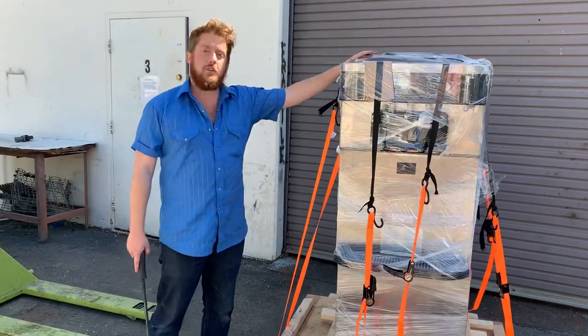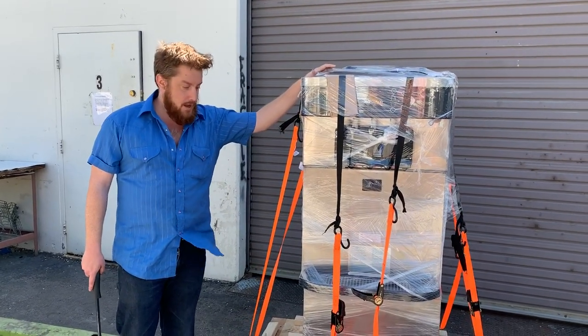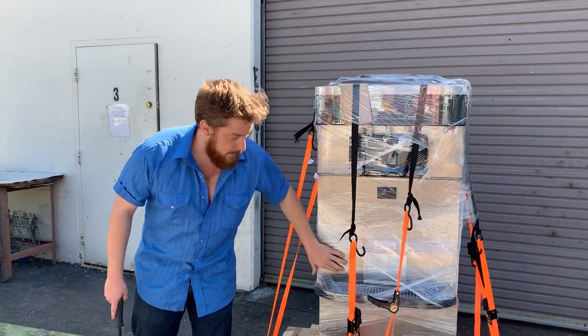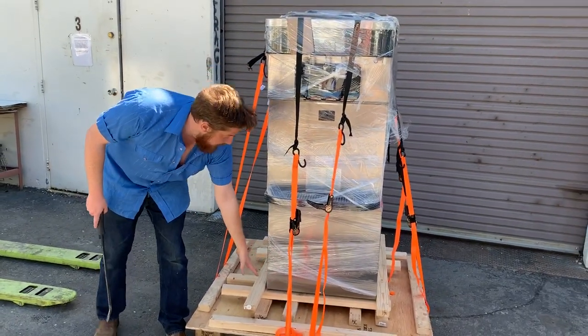What's really important to note is that machines are very top-heavy — ice cream machines can fall over very easily. It's also important to note that ice cream machines don't like large vibrations and bumps. So taking your machine from here down to the ground, you need to use the plywood and the wood that you're about to take off.